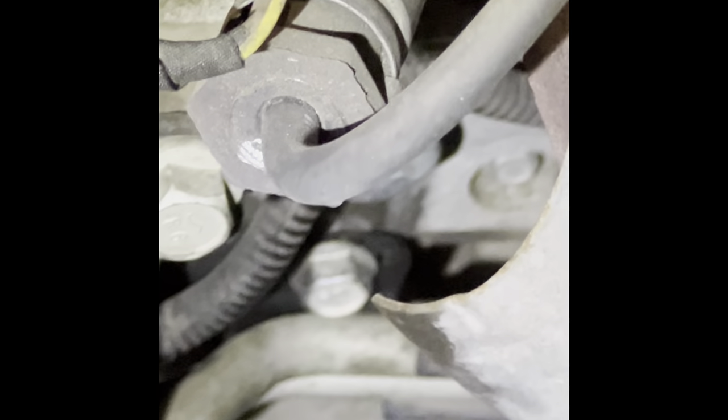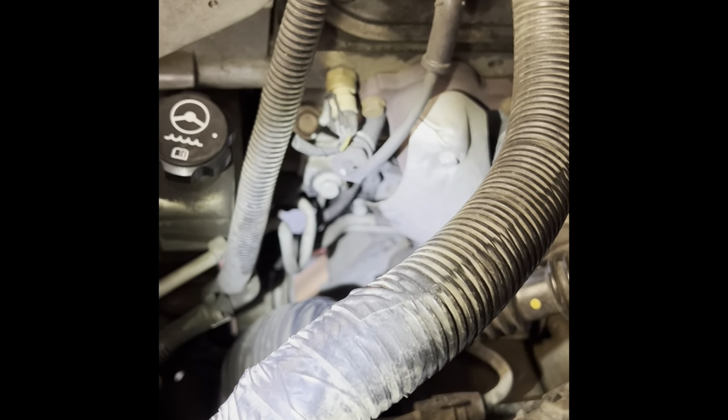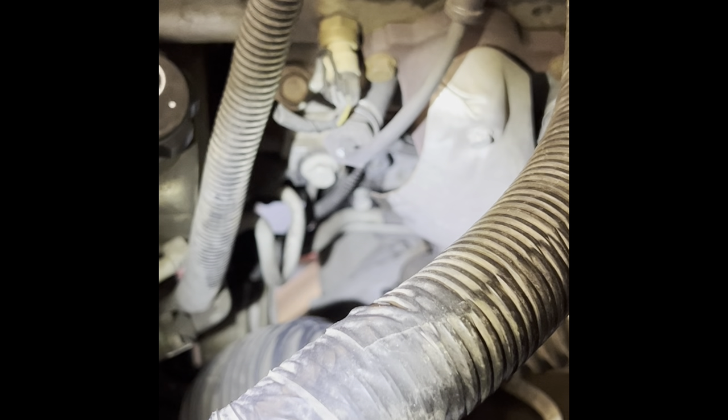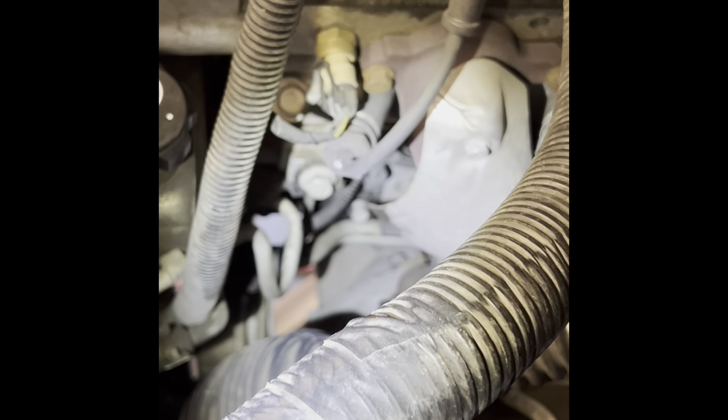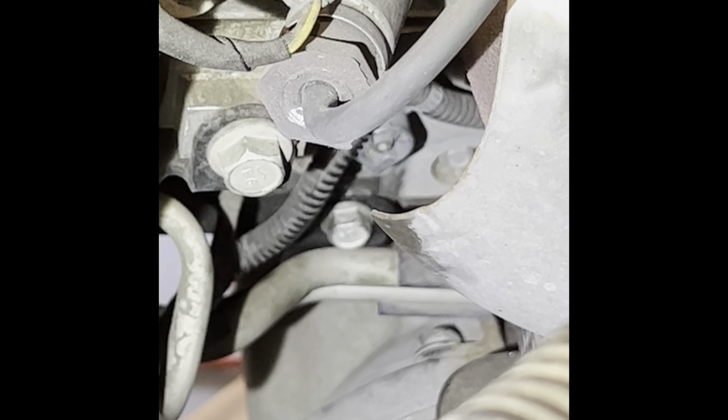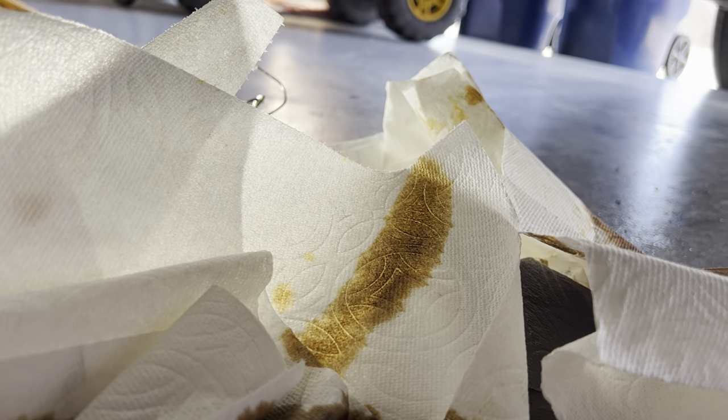Shaky hands - that's what you get when you get old. There's the bolt, it's a 13 millimeter. We're looking at the power steering pump; you're going to have to go above on top of the engine so it's kind of hard. I have my car up on ramps, so you're going to have to put a towel or something soft down because this car is going to tear up your chest really bad. You need to loosen that up as much as you can without completely taking it out, and then once you take the 10 millimeter bolts off it should be easy to slide out the gasket and put the new one in.